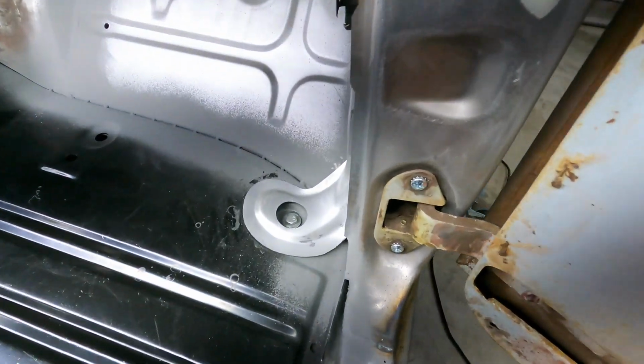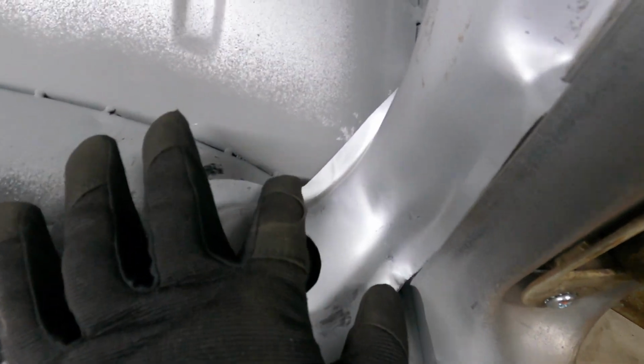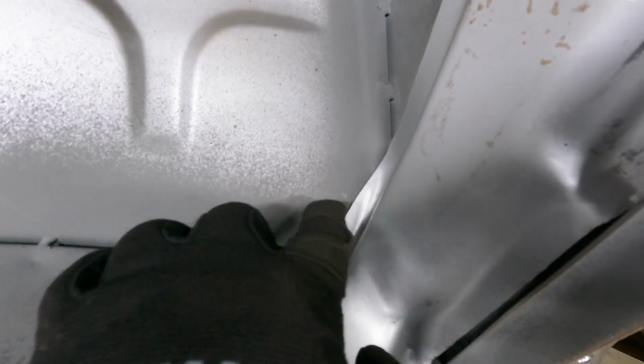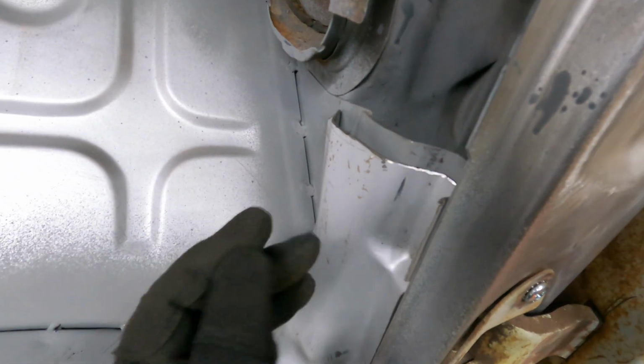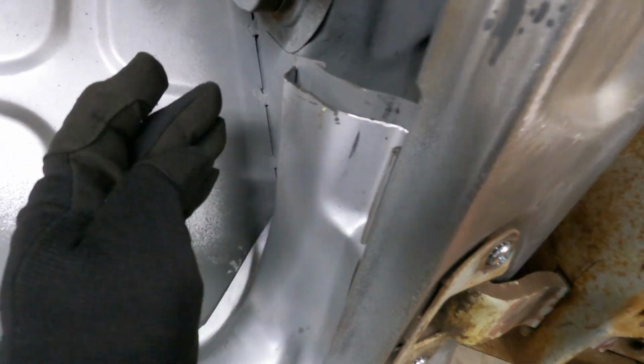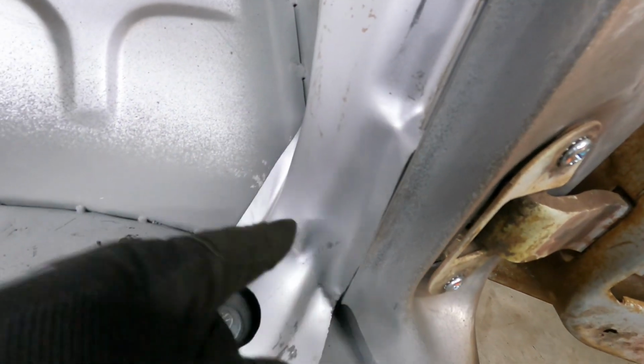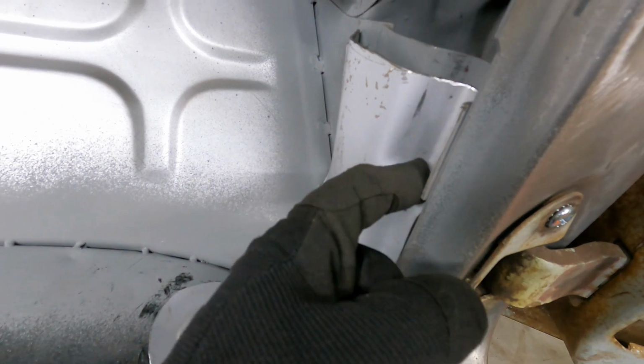Well, this is looking pretty good. It's fitting up, touching down here on the other side, touching the toe board where it's supposed to have a little contact there to weld into place. It's flush in this pocket on the pillar side and also back here, so it'll weld to the brace along most of the flange surface. Actually has weld points to it. This part right here won't. It sticks a little proud from there to there, and then inside the pocket of this panel does.